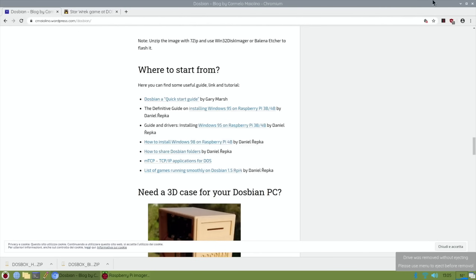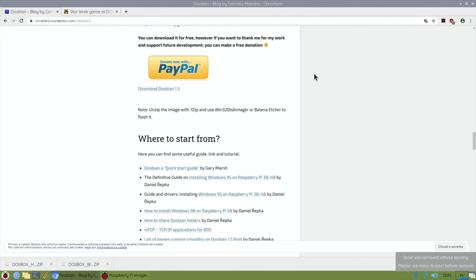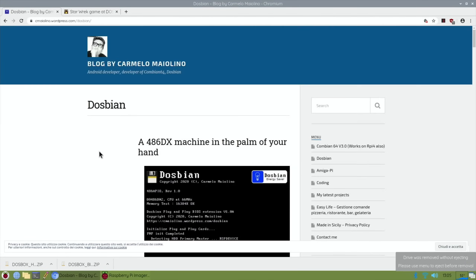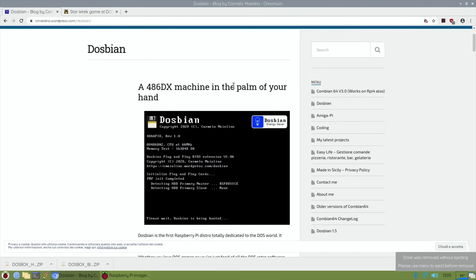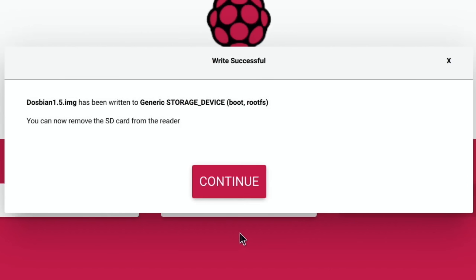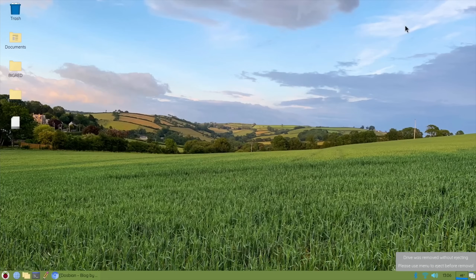So I need to wait for that to finish. Once done, I can hit Continue and close that down. It says I can remove the card, so let's take out the card in the USB adapter and pop it back in again because we haven't finished with it yet. So what we want to do now is open up RootFS, then Home, Pi, DOSbian, Games. You'll see there are two games that come with it already - Doom and Wolfenstein 3D.